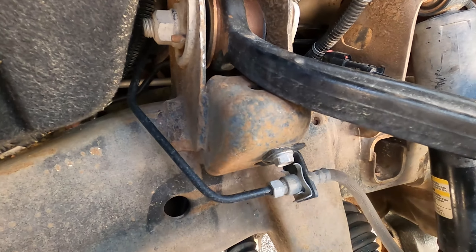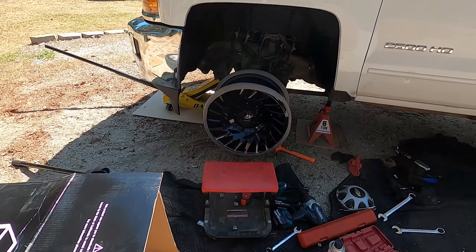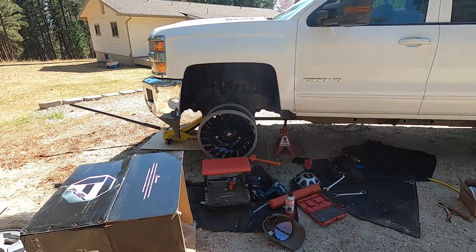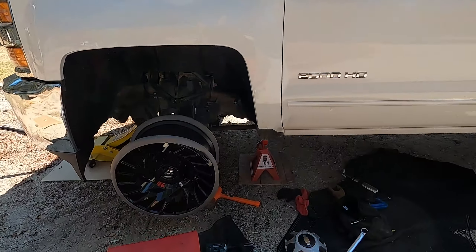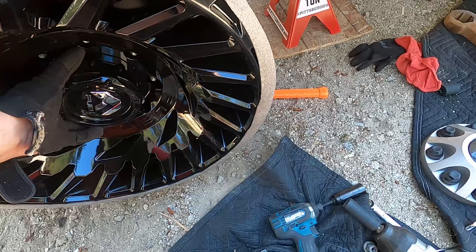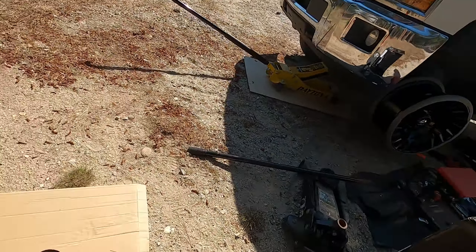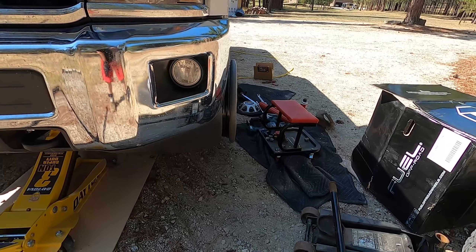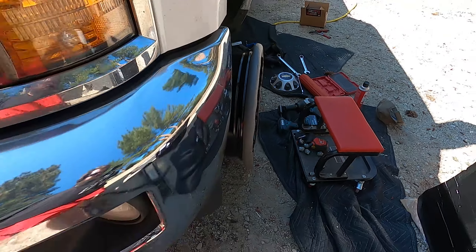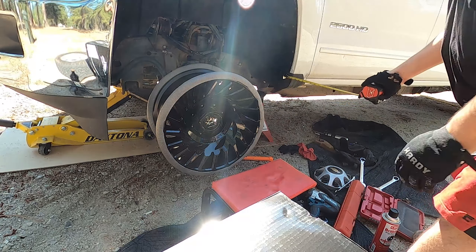The control arm is riding on the bump stop, so we need about a pencil's worth of clearance. Put the truck on the ground first to calibrate. I've got the new wheel test-fit: 20x10 Fuel Cyclone, all-black edition — fake directionals but it's looking pretty good. There's plenty of clearance in the back. There's about an inch or two of poke, which is about as much as I'd want. Definitely going to have to trim the bumper and do a NorCal cut in the rear.